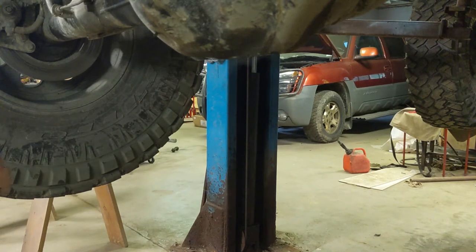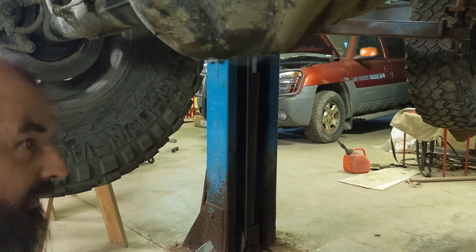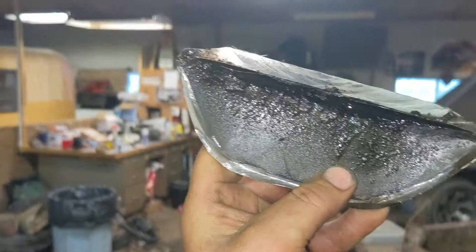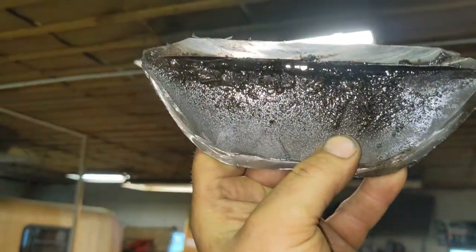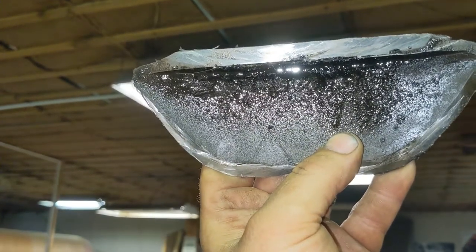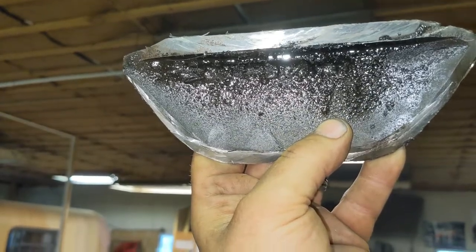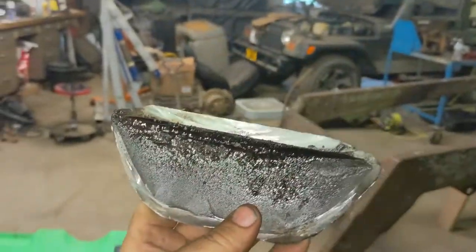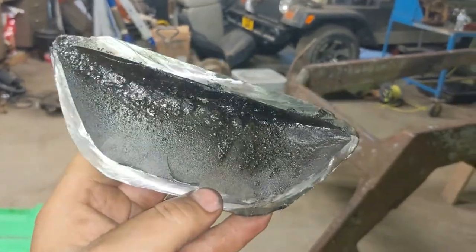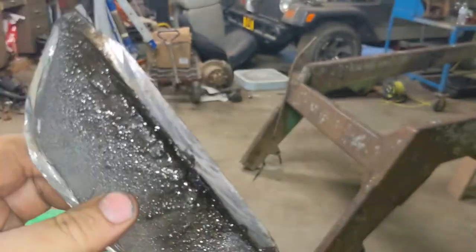Look at that nice flat bottom — it's going to drag us over the rocks a whole lot better. So check this out — this is the piece we cut off the bottom. Look at the holes in there. You can see there's actually a whole bunch of holes along that bottom edge there. We definitely wore through this piece. So we're going to go ahead and use this piece to cut out our template for our new bottom piece. This was reasonably thick steel — you can see it's probably better than an eighth inch, thicker than I thought it was. But we're going to go ahead and replace this with some quarter-inch.